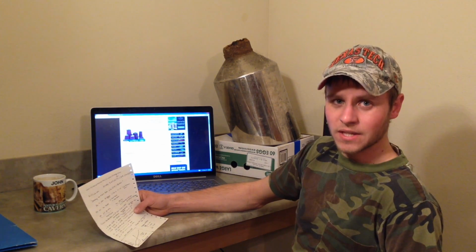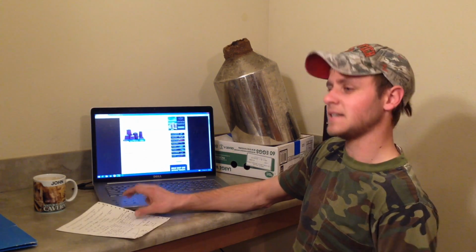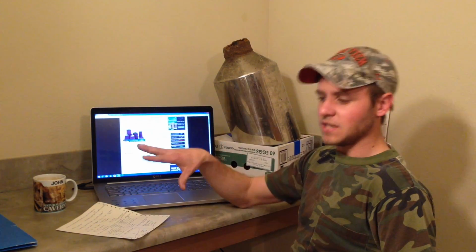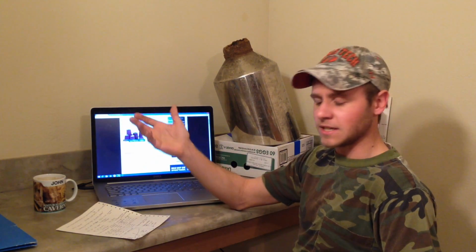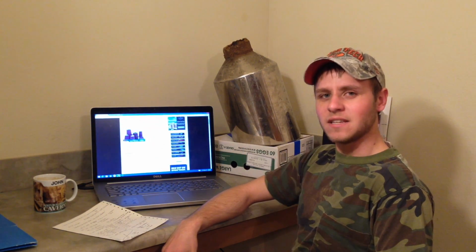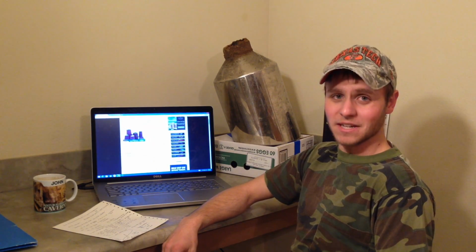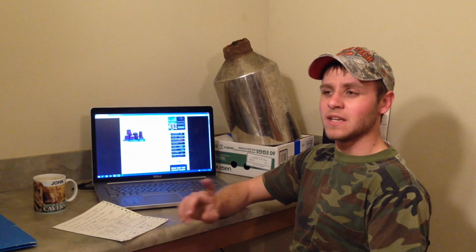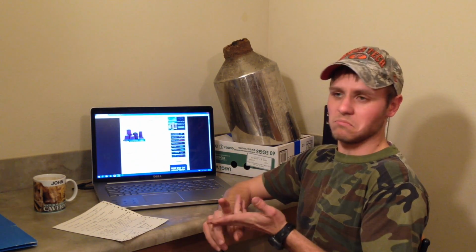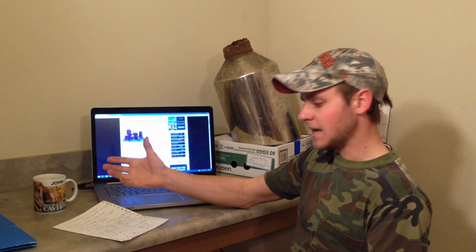And guys, I'll have you know that this is in an extremely dusty environment, but another thing they did was they tested on a very limited time period. What they did in this test was they continued shooting dust at these air filters and had it on a flow bench, so basically air was getting sucked through it, acting just like your engine would, sucking in dirt and contaminants. Well, interesting thing to note was that the AC Delco, the paper air filter, actually held up the best. It took a whopping 60 minutes for that thing to completely get plugged up, to the extent that it wasn't satisfactory anymore. K&N and the AFE were under half. They only took about 24 minutes or so of the same exposure before they got completely clogged up.